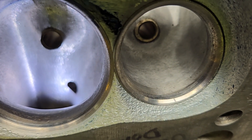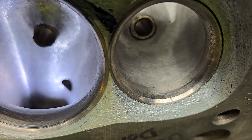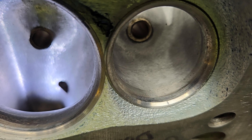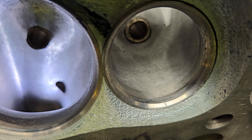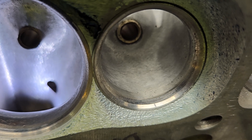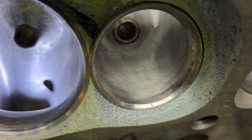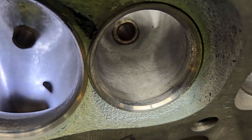The only thing we're going to do to the exhaust is change it from a three-angle valve job to a radius on that inside edge and see if we can gain some out of that. It's already a pretty big exhaust port. You can see this seat actually has the slightest nick on the 45 — not good, but the valve seats are not finished. I got these heads; I think they were originally cut 202 on sixes, so they've been changed since they were brand new.